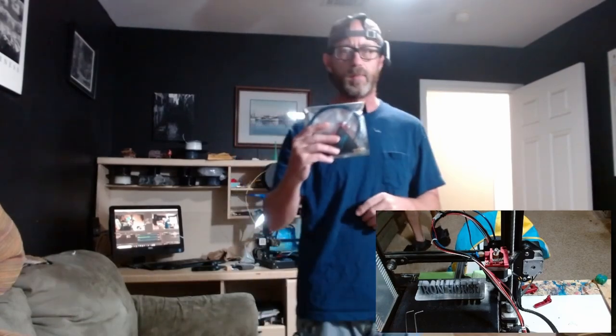Okay, so on the regular extruder, you've got a smooth wheel on one side and a cog on the other side with grips and gears, that grips the filament and pulls it into the Bowden tube. And so what you do with the dual gear extruder is you've got the cogs and the grips on both sides, so you get a better grip on the filament and it pushes it through more cleanly. It's very important and it's very helpful when you're dealing with a Bowden tube.